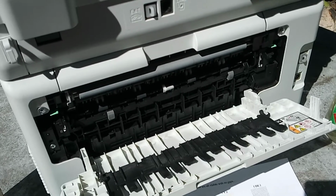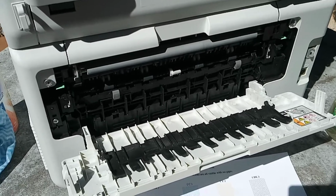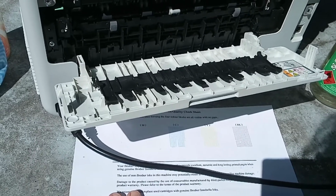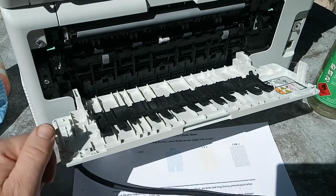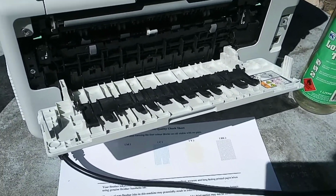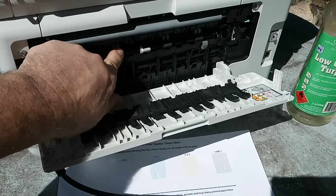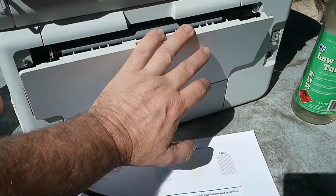And yeah, so hopefully that answers your question as to what the trailing edge waviness on laser printers is. This problem is peculiar to laser printers. All of them, color, black and white. They all eventually get the trailing wavy edge issue, and it usually shows up during winter months when everything's cold and the rubber shrinks and you get issues. So just try that out and hopefully that fixes your problem.